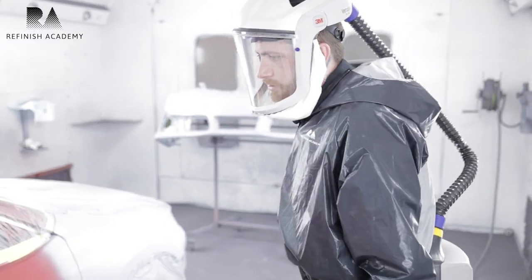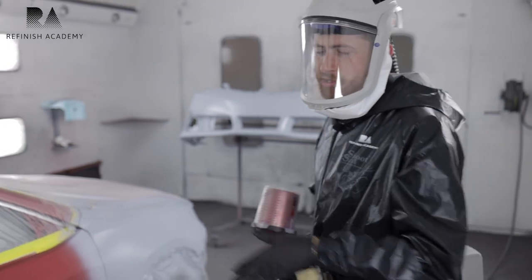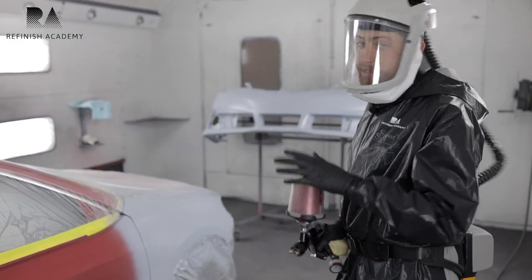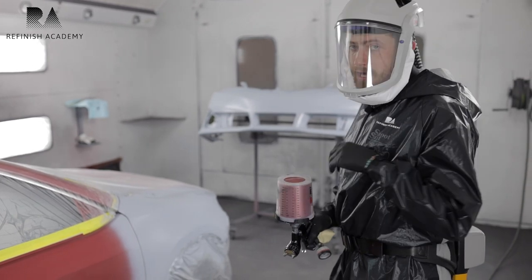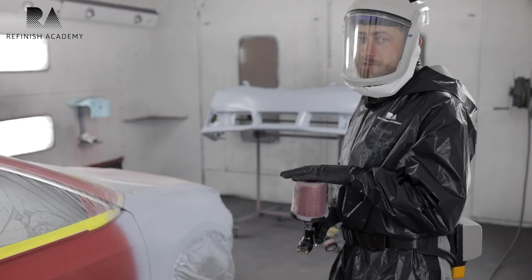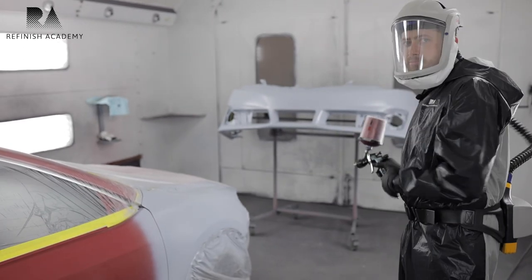So a lot of what goes with painting is time management. I already had my chip, had my color. I already strained my color. Straining your color is very important, by the way. You get a lot of chunkier pigments in there, and straining is a must for base coat for sure. But as far as time management goes, you saw I put adhesion promoter on real quick